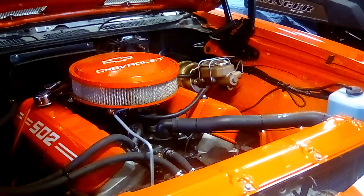In the rear, you need to run a 3-inch exhaust with this, because otherwise you won't get those ratings — that's a must. For cooling, I went with the ECP, which stands for Engineered Cooling Products, with a dual 11-inch fan putting out 3,000 CFMs. I'll show you that right now a little closer.